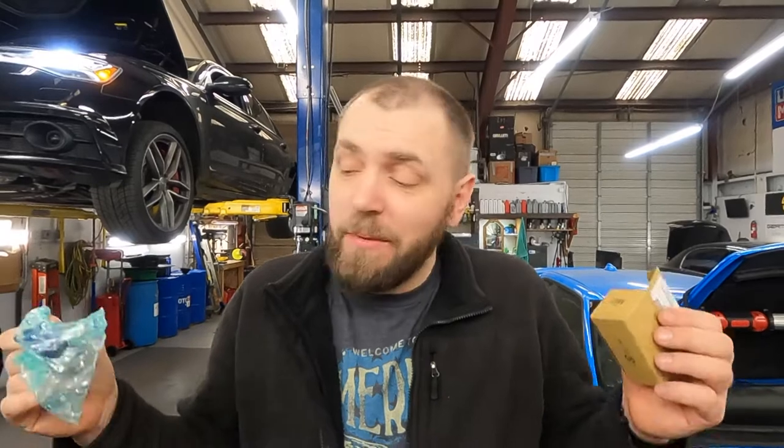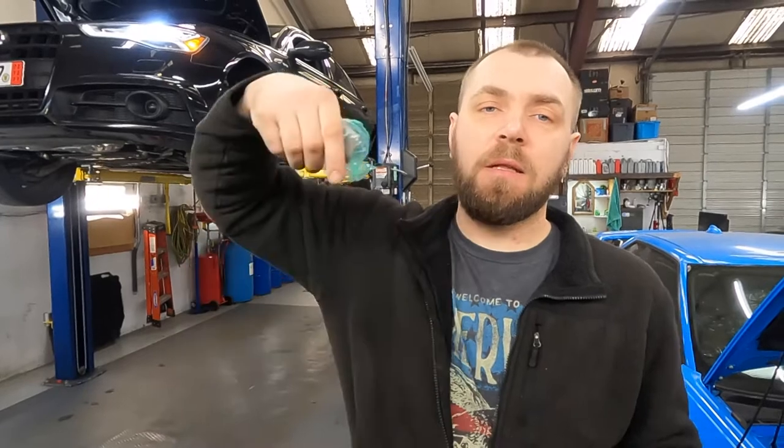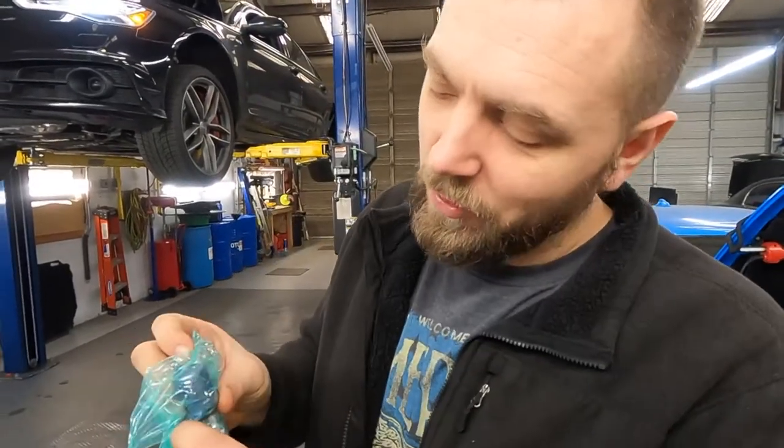Some electrical error. What happens, we don't know, but the dealer actually removed the connector and checked the power supply and output. Everything looks good. Of course, this is a couple-year-old car with low miles, but the valve needs to be replaced. For this replacement, drain coolant, remove the engine subframe cradle, engine mount, AC, and lift the engine on the hoist, and then with two fingers and one small bolt, you take out the valve and then install the new one.